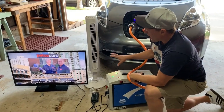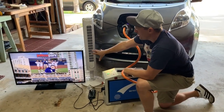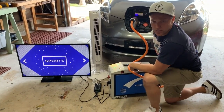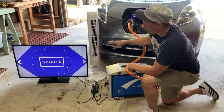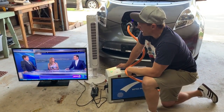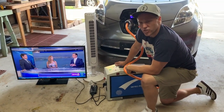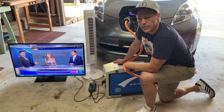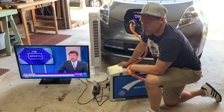In terms of how much power that offers: at this 200-watt draw, if the vehicle is fully charged — this is a 24kWh battery — it could power these devices for five days. Assuming a full discharge, you can typically get at least a couple of days of power for typical household devices in an emergency.